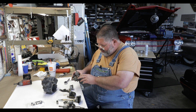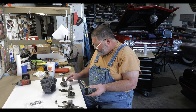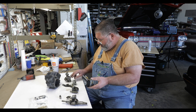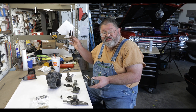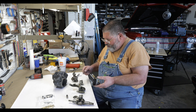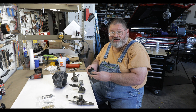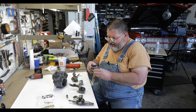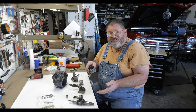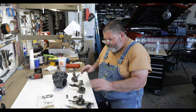And finally, the other part of the system is the airlift. The way that works is: in normal operation this is the exhaust side — it passes straight through. All the lines from the various three valves on the car — the two rear and the one front — all come here. Normal operation exhausts the excess air into the air cleaner to muffle the noise. But if you take the regulated air and push air in reverse through the exhaust system, it will force its way past the Schroeder valve inside. As it forces its way past, it's going to inflate the air bag, which opens the Schroeder valve more — because it's trying to lower the car — but we're forcing air the wrong way, and it will raise the car to full height.